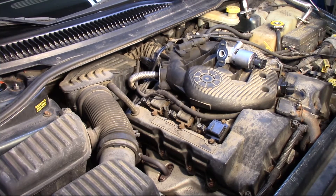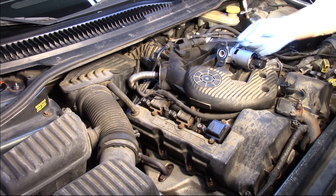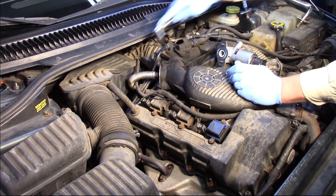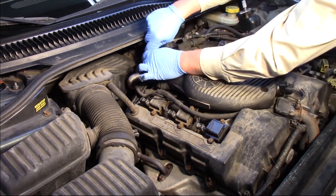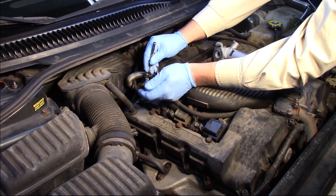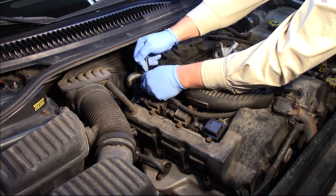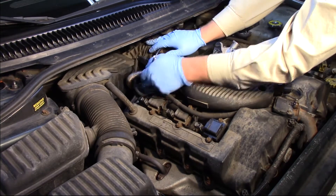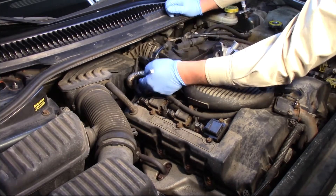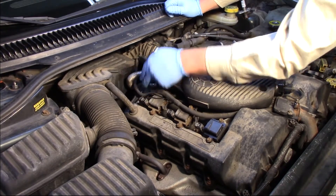It's pretty straightforward. I'm going to use a couple ratchets and wrenches or a couple sockets, and let's go ahead and break these loose and work on these tubes. Then I'll pull the air cleaner assembly off, and that'll give us a lot better access to get down to the back side.